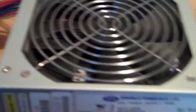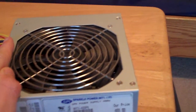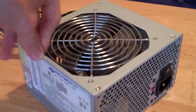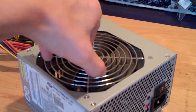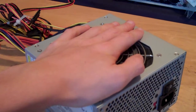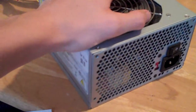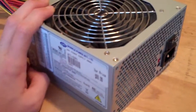This puts out a max of 400 watts on a single rail. I'm going to look at my cheat sheet here since it didn't come with a manual or anything. It has a noise-killer fan, so it's a PWM fan, which means that when the power supply starts to get hot, the fan will spin faster. Full load operating temperature is 50 Celsius — it should run at 25 to 50 Celsius. Efficiency is 70% minimum measured at normal AC at full load, so it's not an 80 Plus power supply, which kind of sucks, but 70% is still pretty good.